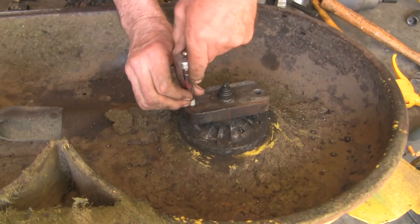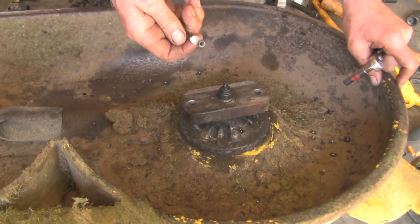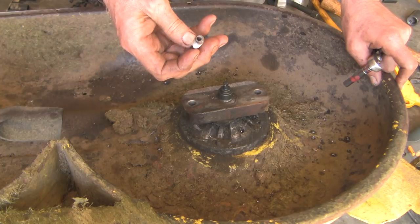After I got the vehicle all buttoned up, I drove it around the garden and to my happy surprise all of the blue smoke was gone and I had loads of power — the problem was solved; it was a dirty carburetor. The thing that turned this into a comical saga was that on my first tool around the garden I ran over some mesh netting, which seized up the blade. I had to take the blade off, broke a metric bolt in the process, and had to drill out the remaining fragment — but at the end of the day it's all good. If this video helped you out, hit like or subscribe or leave a comment. Thanks for watching.